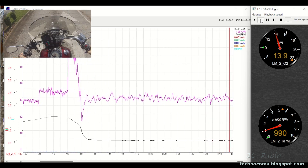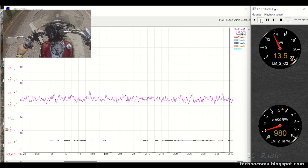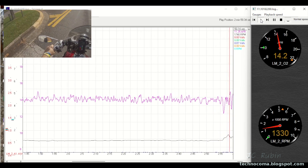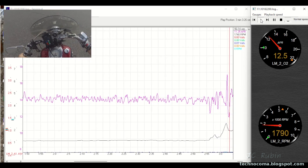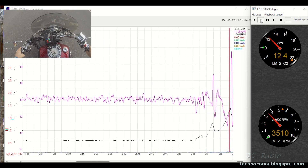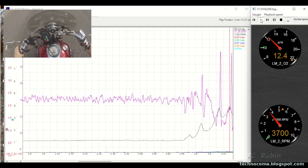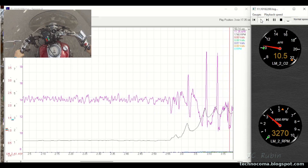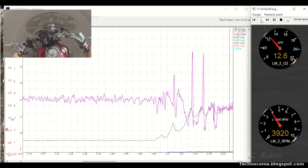This intersection has a very long light, but it gives me time to look at my idle mixture. We seem to start off just fine on the launch, though I'm slowly taking off on a turn at an intersection. Until we start giving it gas coming off the mid-range, we start richening up again, and at some point we get really rich and stay there. If I'm seeing the 11s, it's too rich.